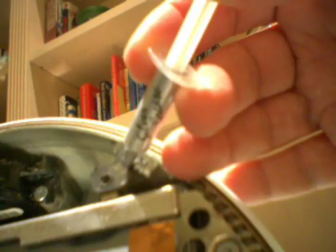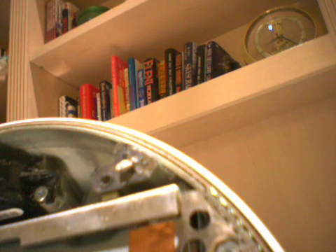The thing is, now that I've broken the connection between this side and this side, I have to reapply some of this stuff. Some of this stuff — which I'm lucky I have, because I built a PC about four years ago. There's this silver compound, this heatsink compound. I shouldn't have to use this — this is the only Mac that you ever have to use this stuff on. It's a heat-conducting compound so that the thing doesn't overheat and die. Hopefully. One never knows.